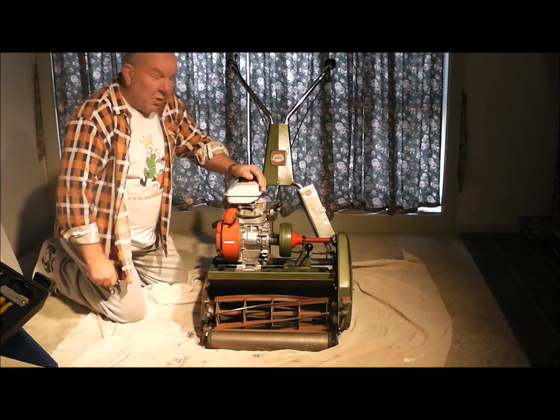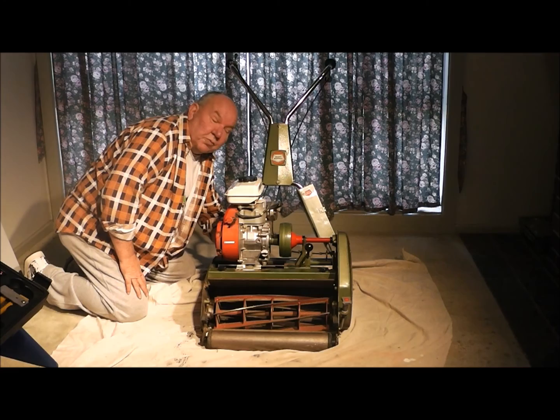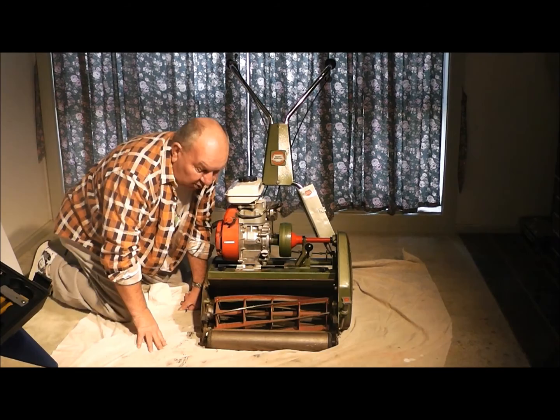Remove the nuts. You'll notice also on the nuts there is a spring washer and a flat washer, which is quite important — you want these to be nice and tight down on the twin rails. You will also see on the side that there are a couple of threads there about the rails cracking, and cracking is caused by vibration. So it is always very wise when you're doing routine maintenance to check these particular four nuts that hold the engine to the frame and make sure they're nice and tight.